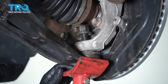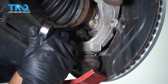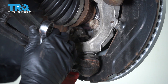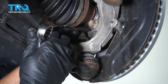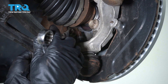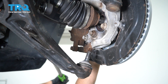That's loose right there, so I can lower the pole jack. Luckily, this is loose enough that I can just take that nut off and pull it down. Otherwise, you're gonna need a special tool to separate the ball joint from the knuckle. Now I'm just gonna use a pry bar and pry down the lower control arm to separate it from the knuckle.